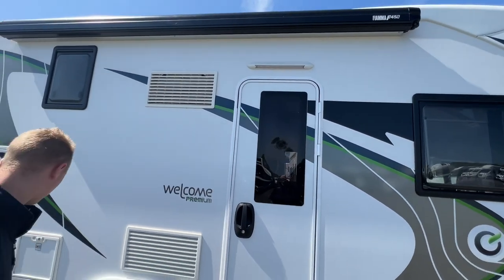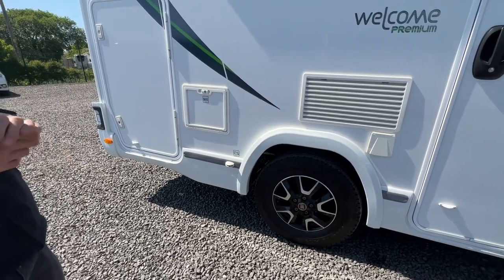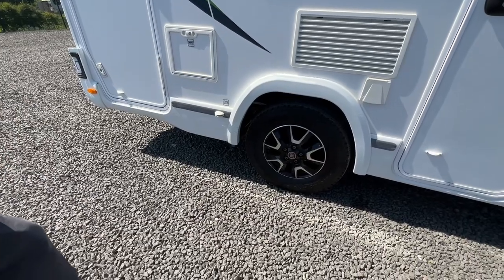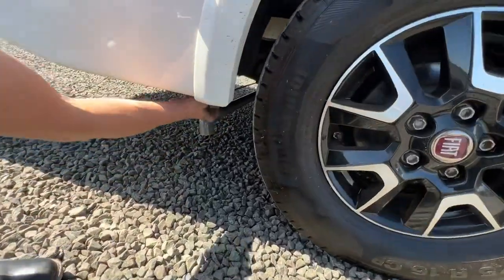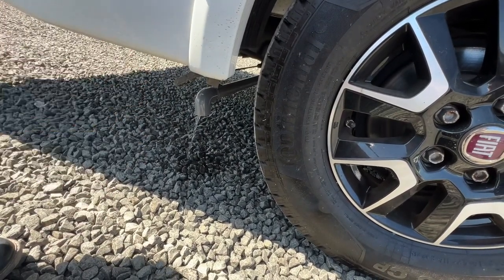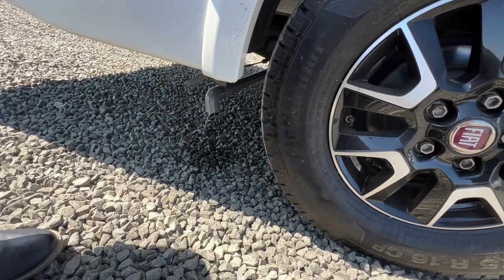You do have your awning light above your habitation door. Located behind the back wheel is your waste water - this is any water that you've put down any plug hole. It's very important that when you leave site you get rid of your dirty water, as it adds weight and uses more fuel and impacts your payload. Drive over the grid on the way out of the site and pull the handle so the water comes out. Leave this open a jar when driving home to let any loose water out, and in winter make sure this is fully drained off to avoid frost damage.